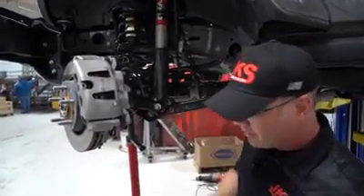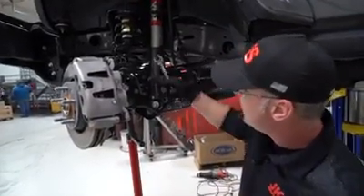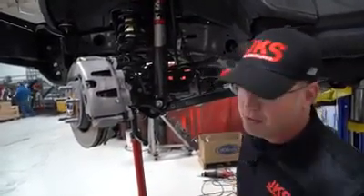We're putting our shock back together using an 18 millimeter wrench and socket. Then we'll get the brake line back on, and when we finish the other side we'll go ahead and do the sway bar link.